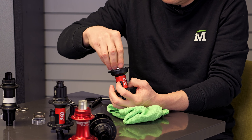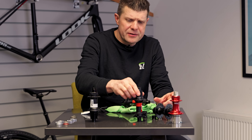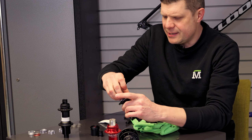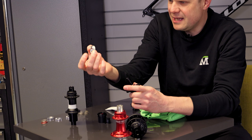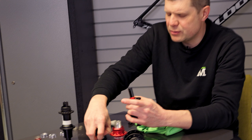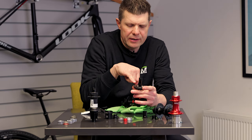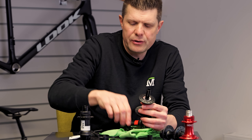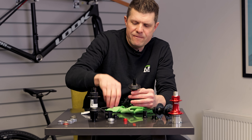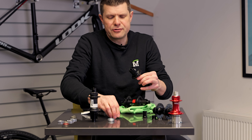Let's show you how simple that is — quick bearing press off camera, push it all together and we are good to go. For context, this video deserves a little bit of evolutionary history. This is the old 240 design — this section here is threaded into the hub and you do actually need a special tool to remove it. This one uses a red aluminium spacer to space out the bearing — it's an easier tool to use than the lock ring tool on the 350 — but it is still a special tool. I still think this is a very nice road hub, but for mountain biking it's definitely nice that those bearings are now an awful lot easier to access and service.